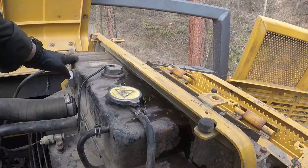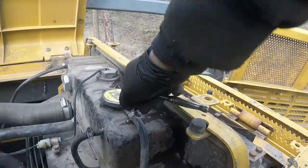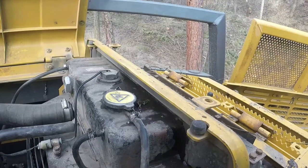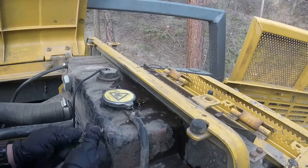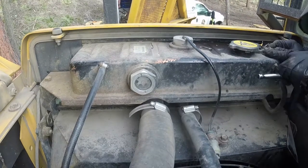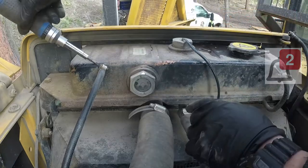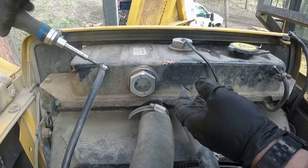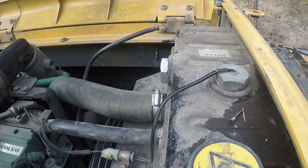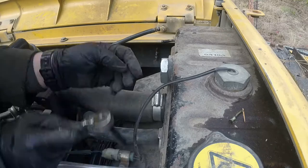There's a lot of debris. There are hoses and an electrical connector — there's a coolant level sensor that needs to be disconnected. I would recommend you sort all bolts and nuts separately to make sure you won't run into the issue of not knowing which bolt came from which place, because we'll have quite a few.